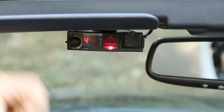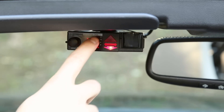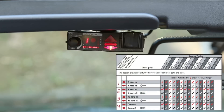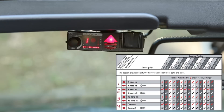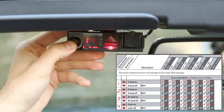We're going to press this button a second time and this will drop us into the menu options. You'll see a number — one, two, three, four, five — then A, B, C, D, E, which lets us know which option we're working with. The up and down arrow generally indicates whether a feature is on or off. Number one has to do with X band: arrow up means X band on, arrow down means X band off. I have the arrow down right now which means I have X band turned off. To change it, simply press and hold for a couple seconds and it will shift to the arrow up.